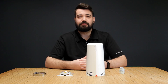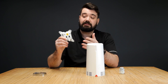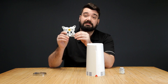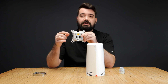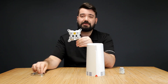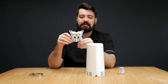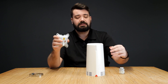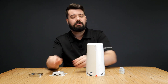To set up your router for outdoor use, you will first need to grab your wall mount bracket. This wall mount bracket has an upside facing — you'll see there are two arrows facing upwards, this would be the side that you need to mount against the wall. You will see there are four holes, and you do get the provided bolts for wall mounting, and also two C-clamps which can be used for pole mounting if you wish to proceed with that installation method.